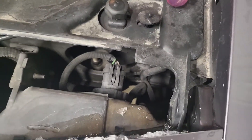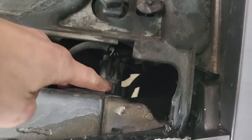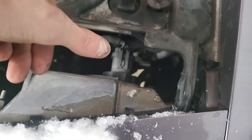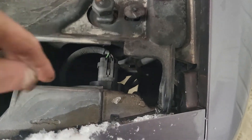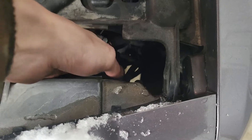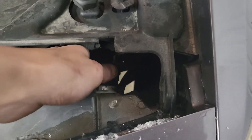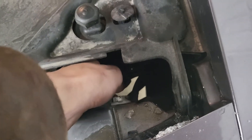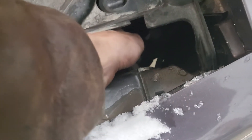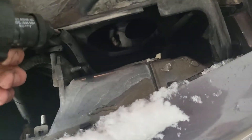You just take those off. Now, how you're doing that: this is a retainer ring here, and unlike a normal headlight where you put it in and turn the headlight clockwise or counterclockwise to get the bulb to stay in, these ones you don't have that. It's just this ring here, and you just turn the ring counterclockwise and the whole thing comes out just like that. This one is all crusty and hard to get out. There's one.